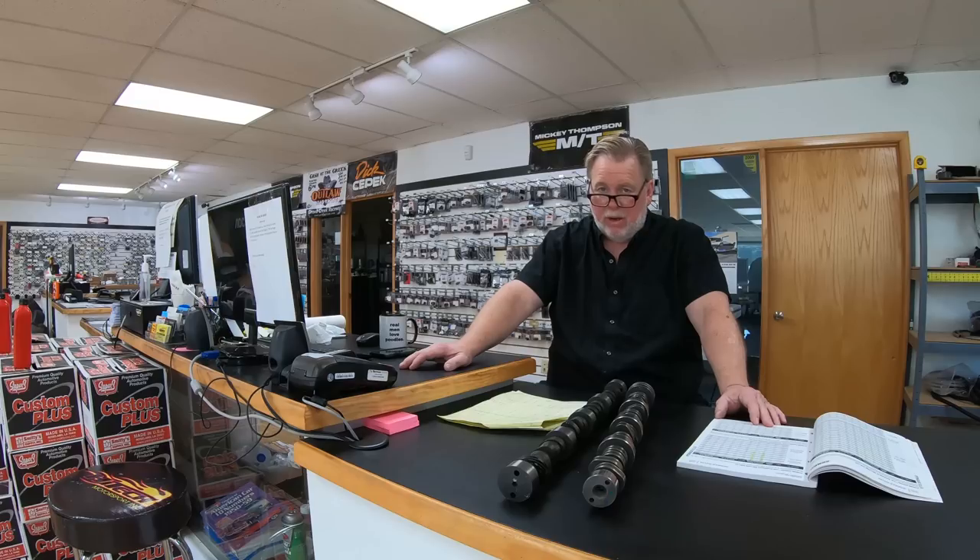The LS2 cylinder head is pretty much the same as the LS1 as far as flow numbers, so these camshaft recommendations work for both LS1 and LS2. There are always questions about intake centerline — advancing or retarding. Guys doing big cams like a 236/252 on a 116 LSA and then advancing it six degrees are just trying to put the timing events back in play and make it sound like a box of rocks. To me it sounds like you're wasting fuel, and it's really not good for anybody.